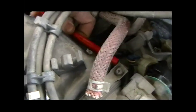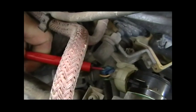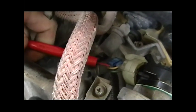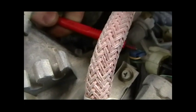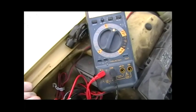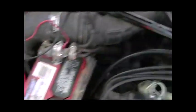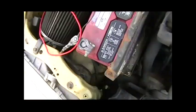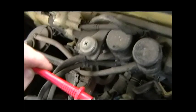Eventually you'll contact some metal. I don't have one of those thin probes, so what I did is I took one of these electrical tappers that you typically use for hooking up trailer wires, and I stuck that on there. It actually cuts into the wire, and there's another hole in there — I just jam this red thing into the hole and it basically indirectly contacts the wire. Then you set your volt ohm meter to measure up to 10 to 20 volts, and stick the negative probe grounded somewhere — I just stuck it on the negative battery terminal.